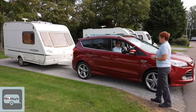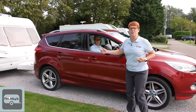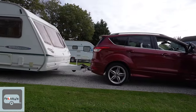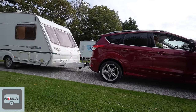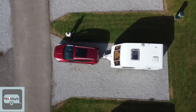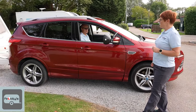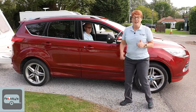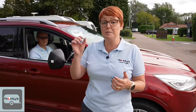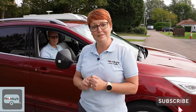Stop there. Another reminder: the last maneuver when you've been going backwards with a caravan or trailer is always a pull forward — it re-engages the overrun brakes and it pulls out the draw bar on the hitch. Andy, if you could just pull forward for me. Wonderful, hold it there. Thank you for watching — I hope that was useful. If you've got any questions or observations, please pop them in the comments below. Don't forget to like and subscribe — see you later!